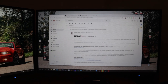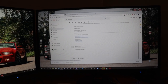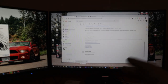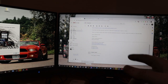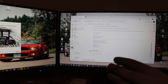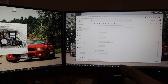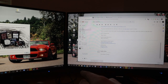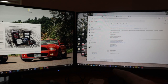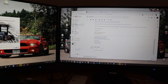Bama sent me an email with the tunes based on the mods I've installed — shout out to Sean from Bama. I have an 87 performance tune and a 91 race tune. In Oregon we can only get 92 octane gas, and since there's no 92 tune option, you request the next lower — so 92 gas uses the 91 tune. The catch is if you upload the 91 tune you can't run 87 gas. For now I'm uploading the 87 tune so I can run regular, then I can bump to the 91 performance tune later. I've downloaded both tunes and dragged them to the desktop.